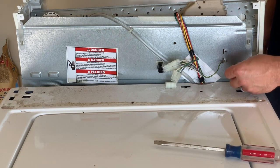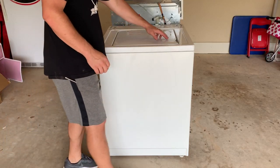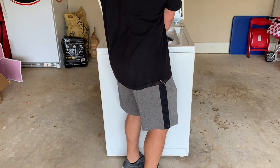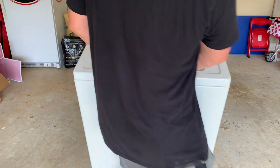This one is now free as well. It's okay if they come out — they just slide right back in. With both clips out, I can open the lid of the washing machine, stick my hands inside, and it simply lifts off.